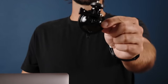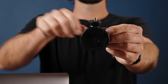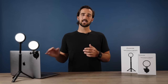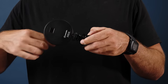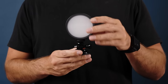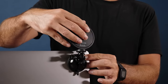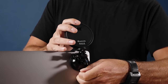Now let's get into mounting options. First, the suction cup mount is included in both the Light and Light S editions and is great for mounting to any flat surface like a laptop, desktop, or iPad. Before mounting, make sure the surface is dust-free and clean. Simply screw your video conference light onto the top of the suction cup, then use the tension disc to angle your light in the desired direction. Once you've found your location, lift up the latch, press the suction cup against the surface, and close the latch shut. To remove it, lift the latch and pull the suction cup away.